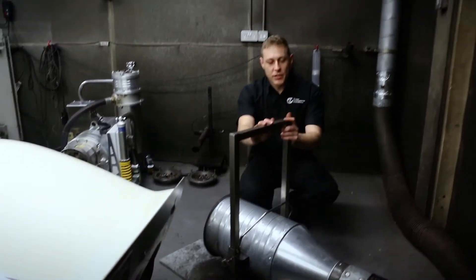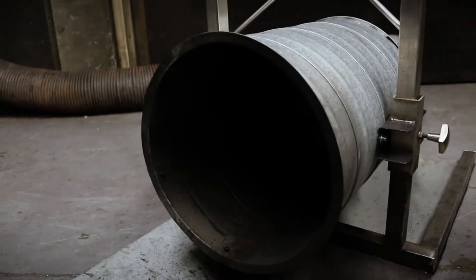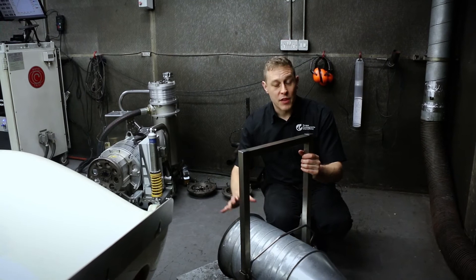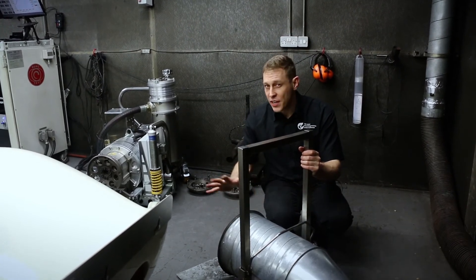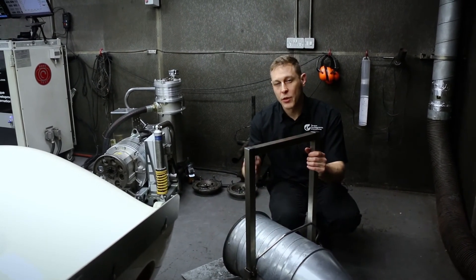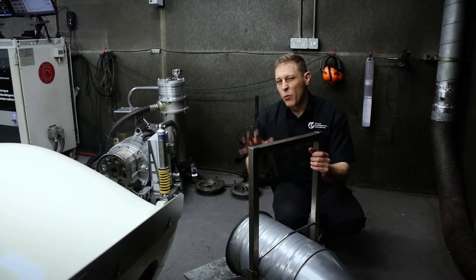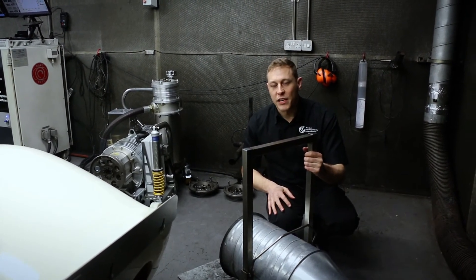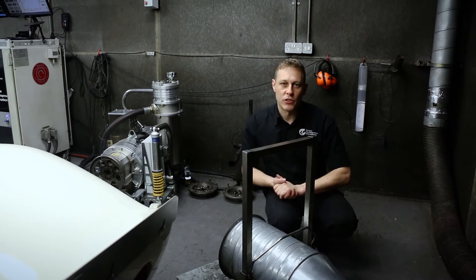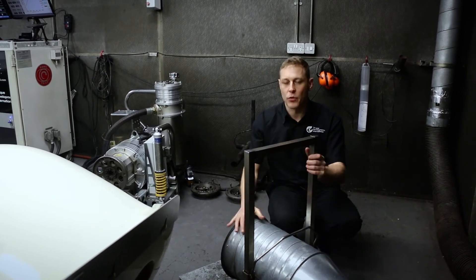Here we have lastly but certainly not least exhaust extraction. There's another 8,000 cubic feet of air per minute going out of our exhaust extractors here to keep the cell free of exhaust gases from the engine. It might sound over the top, but exhaust gases from petrol engines — even normal pump petrol — are extremely poisonous in a way that's not immediately obvious to the person who's being poisoned. Carbon monoxide causes you to effectively drown and you don't realise until you lose consciousness. Worse than that, a number of cars that we're asked to tune in here are running on very highly volatile and quite exotic race fuels. Some of these race fuels have really quite dangerous additives in them — we don't want to be breathing them at all. A really important part of our dyno cell.